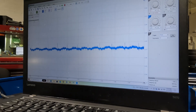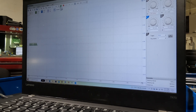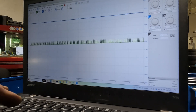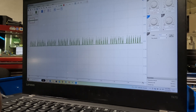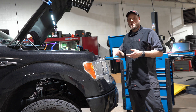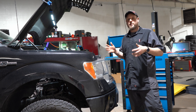So all the injectors look like they're all firing. Now I'm going to unplug this coil and show you what it would look like with the coil gone. There you go — you see one, two, three, four, five, six, seven — there's no eight. So if I do the RC test first and it looks good, I do this and the coil is not firing but the injector is good, then I know that I'm looking at a coil or a wiring issue with the coil.